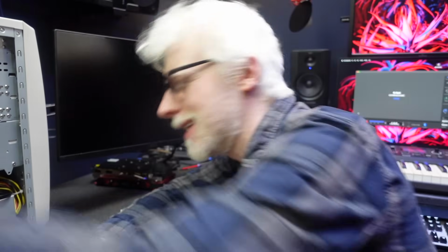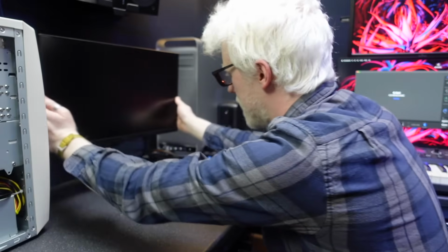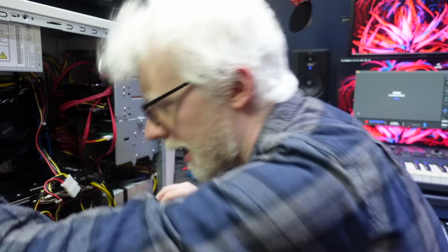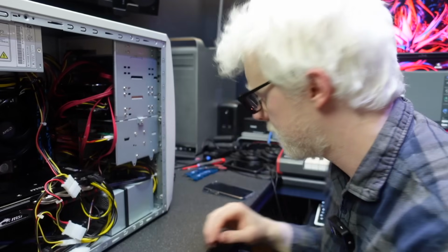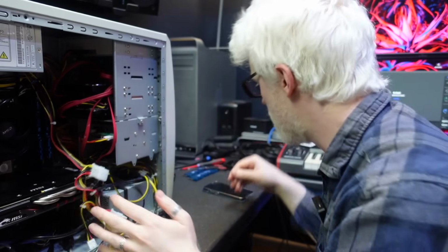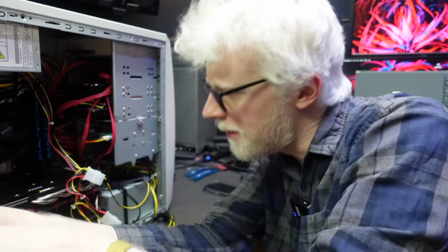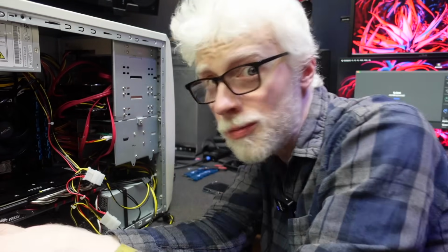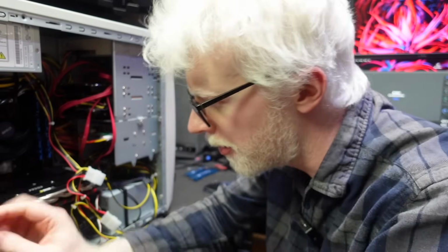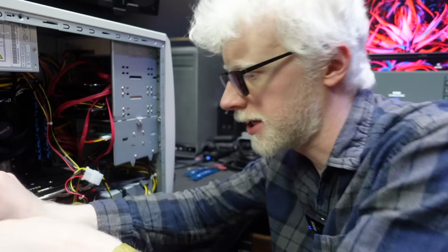That's it. That's the last one I'm doing. There's no point, no physical point at all to rocking this GPU. So we've tried and we've failed. I am putting the other GPU back in. I'm flipping that BIOS switch. We're going to see what the system does with that. If it acts exactly the same as this, cool, that's fine. We don't have to worry about drivers messing up or anything because we don't have any proper drivers installed. So in other words, everything is fine for us to swap this out.